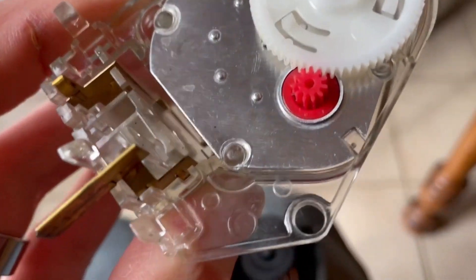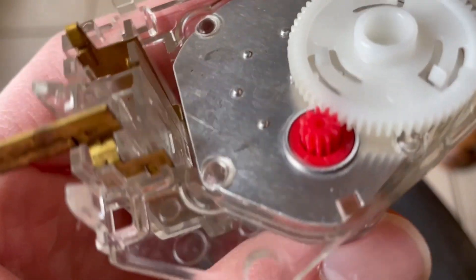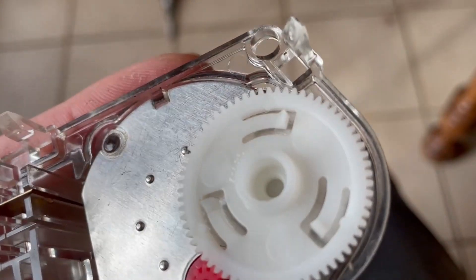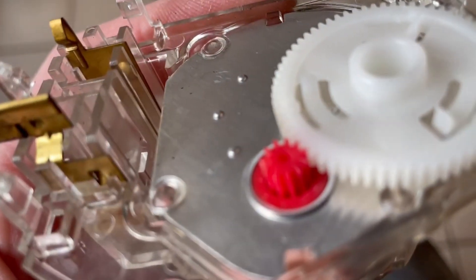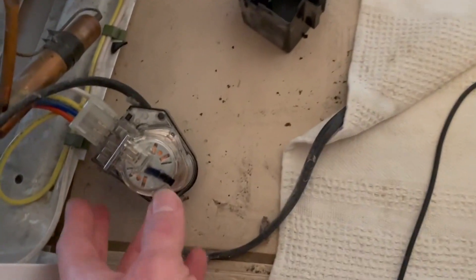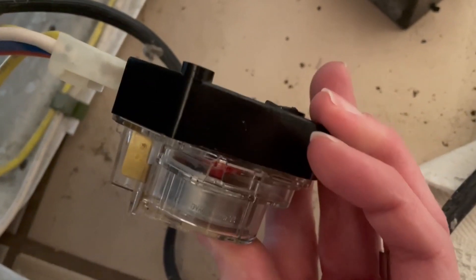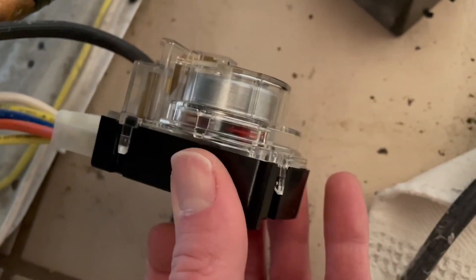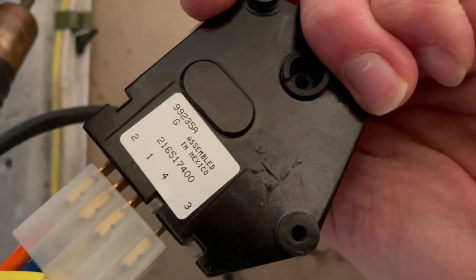I was going to take it apart, but getting the plastic welds off isn't worth the effort right now. I plugged it in to listen and see if it's turning without a load. Even better — I went ahead and popped it back together and plugged it in, and the compressor is running now. It could stop next time it hits a defrost cycle though. So we'll just be ordering a new one — it's got its part number on the back — and be back in business.